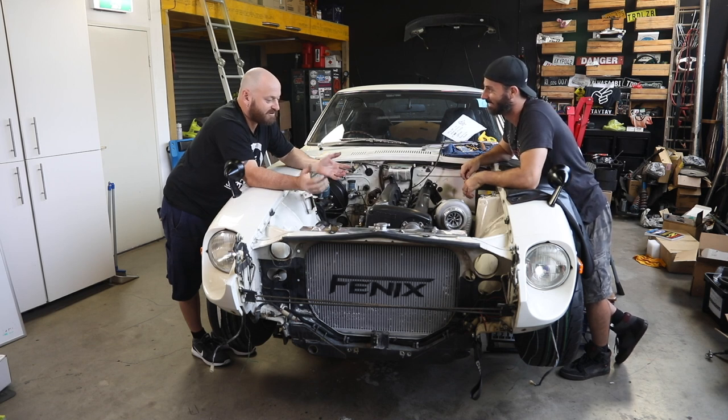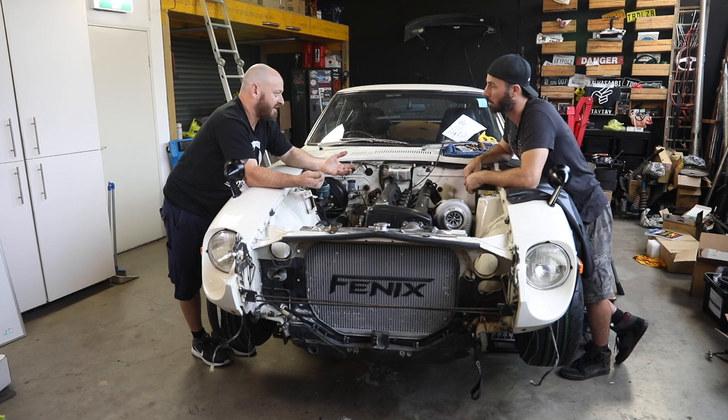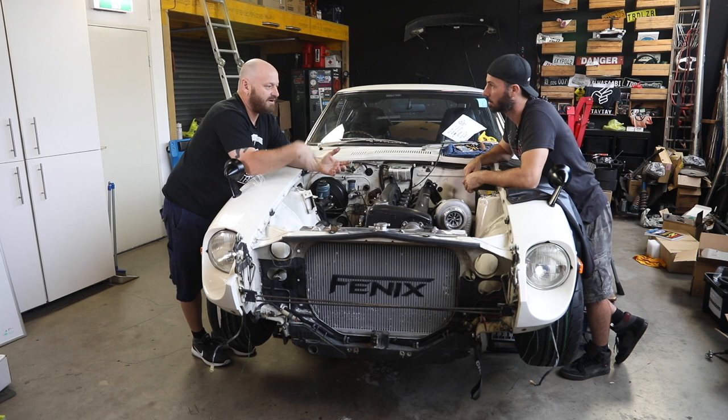So basically, it's got fuel in there, there's fumes. We drain the tank, but there's still fumes in there. So we've got to cut a hole in it, we're not welding it or anything like that, but you're still cutting things. So to make it a bit safer, what we do is get a car, run it up to temperature, shove the exhaust pipe over the fuel inlet, and the inert gas that's coming out of the car, we just run it for half an hour, and it purges it, basically.